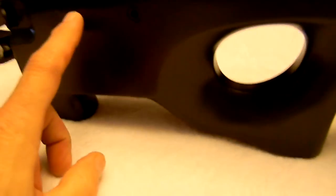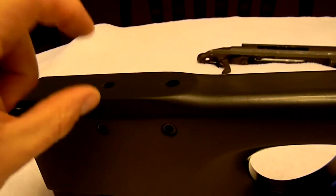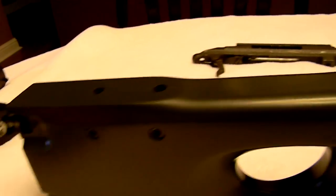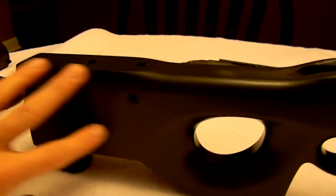And what you do, and you can see I left these areas hollow because you really don't need a bunch of support up here. So what I did was strip out the inside as necessary. Of course, you want to be careful. There are steel collars back here for the bolts that go in, so you don't want to grind those out, obviously. And you want to be careful with the little plastic risers and the spacers in there, and there are little slip washers for the metal, so as it tightens it pinches up. But basically you get rid of everything back here, you just gut all this.